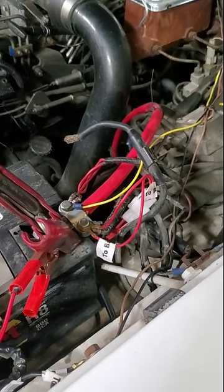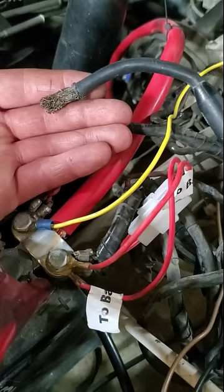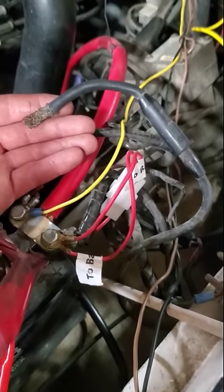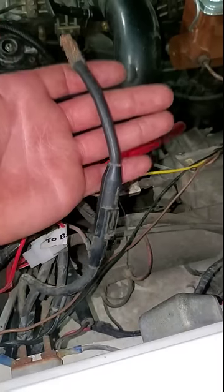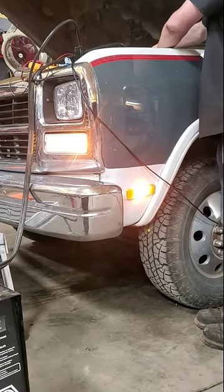So here's what caused all this. Somebody forgot to connect the alternator charge wire to the battery. With this wire disconnected, the voltage regulator can no longer see alternator charge voltage, so it calls for full output. And it just so happens this circuit ties into the lighting circuit through this splice connector. Watch the alternator try to kill these bulbs when I disconnect that wire.